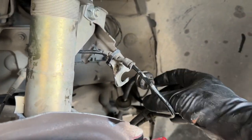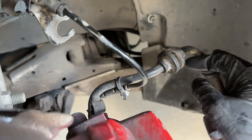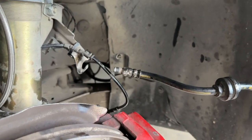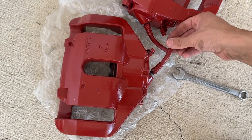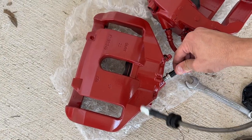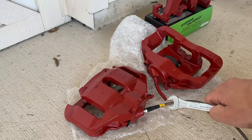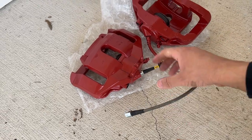These little clamps are held on very tight so you literally have to pull as hard as you can — be super careful not to cut yourself. Have your drip pan ready for the caliper connection point. With the old line removed, here we have our new stainless steel brake line. We'll twist it right into place off the car — this is genuinely the easiest way to do it — until it reaches a stopping point, torque it down, then it's ready to go on the car.